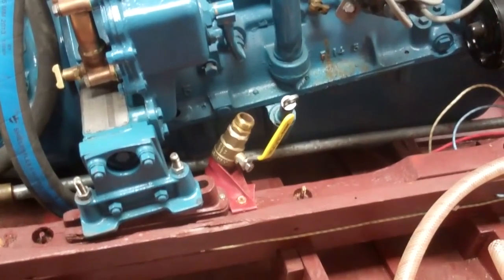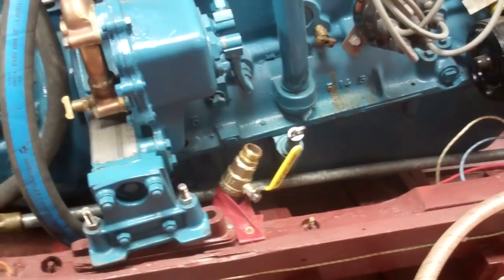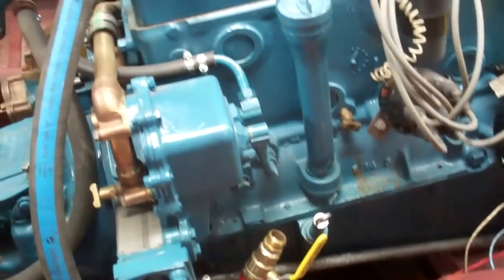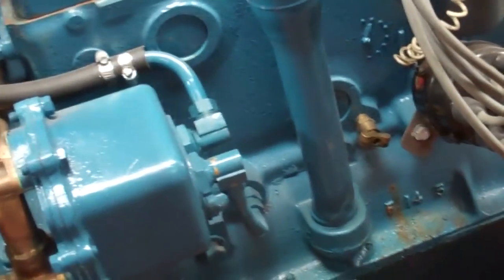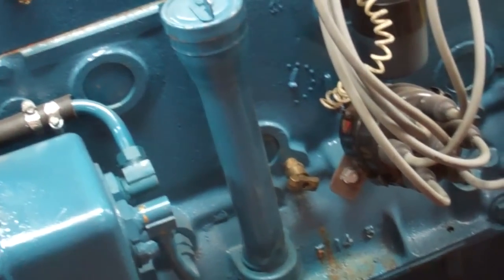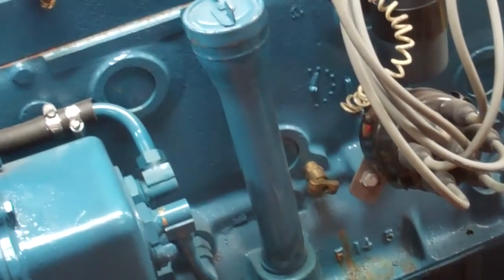Remember that the moment the antifreeze turns funny colors coming out — depending on what antifreeze you use — is not the moment to stop. An engine like this will require at least five gallons of antifreeze. Then we'll open this petcock right here — there's a drain right here and one on the bottom of the water pump. Antifreeze is good stuff, and it's even better if after you've got it through the engine you drain things out just in case. It's the cheapest insurance you can buy — antifreeze is really cheap versus the motor.